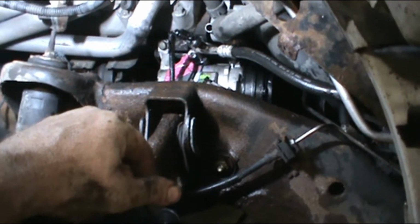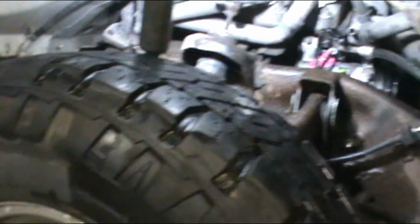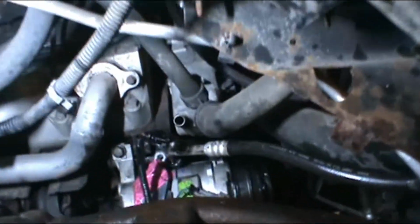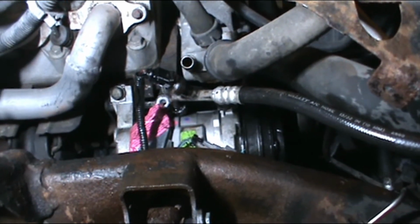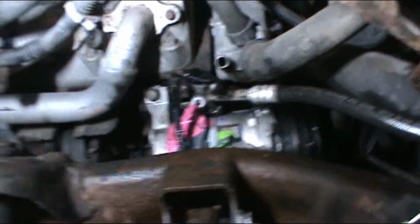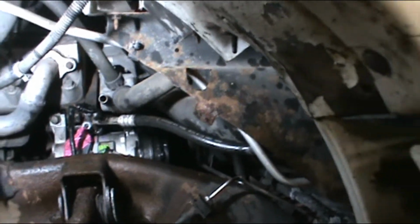But anyway, put those hoses all back on, clean up and get a shower, call it a night. Tomorrow morning we will pick up with pulling a vacuum on the system and recharging, and put some antifreeze in it, and see if my air conditioner actually works again. And we'll probably pick up some more of these stupid things, because, you know, reasons. Alright, out.